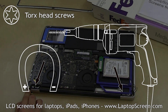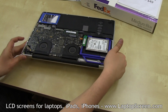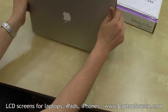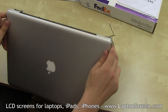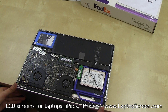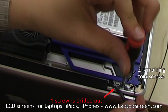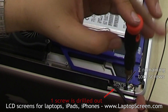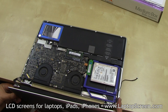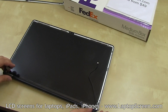Drill down into the center of the screw until the cap is separated. In order to easily remove and later replace the display assembly, the hinge has to be open at a 90-degree angle. The best way to achieve that is to hang the computer off the table with the display assembly open and coming down over the table. Go ahead and remove the Torx screws on each side. Gently lift the display assembly, minding the cables on both sides. Set the computer body aside and place the display assembly on the table.